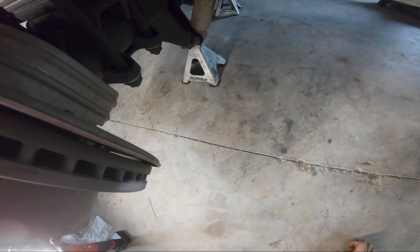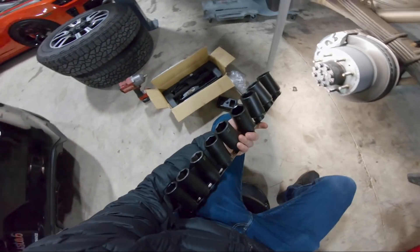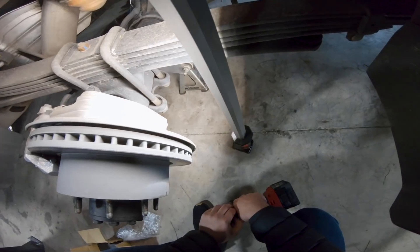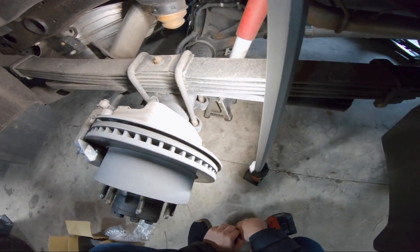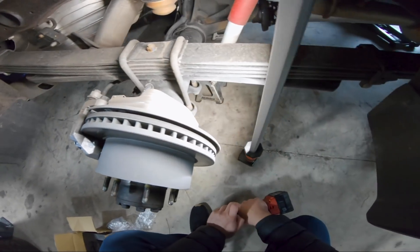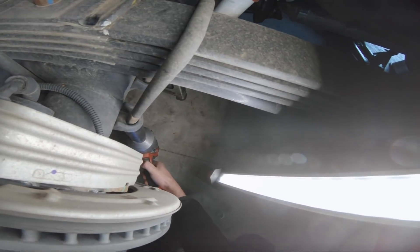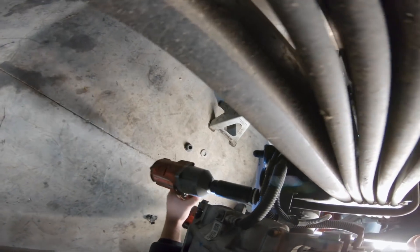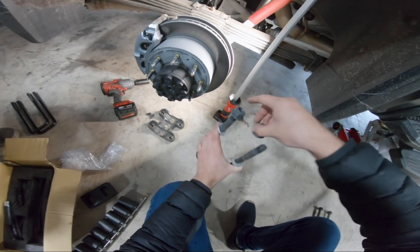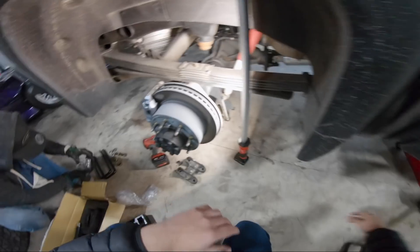It's actually really nice though. What size are those U-bolts? Large. I think this is going to be the first time I've used these giant sockets. For those of you that do not know, SKTools is my tool sponsor — also happens to be the best tools on the planet. It's a 27. What we're going to do is take off the two nuts on the front and the two nuts on the rear and get these U-bolts off. Alright, so I've got the two U-bolts off on this side; Doug's got the two U-bolts off on that side. Now our axle is completely free of our leaf spring.